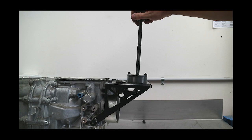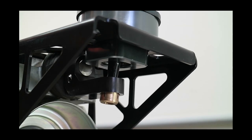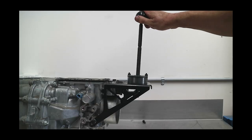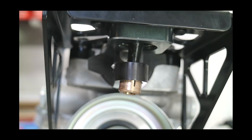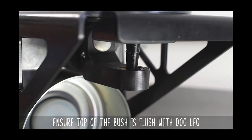We made it like this because you will notice when trying to select reverse that the bushing may get stuck in its downward position as shown here. The bushing cocks to the side in the dogleg, causing damage and loss of the bushing. This is because you need to adjust the bracket properly.